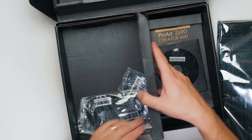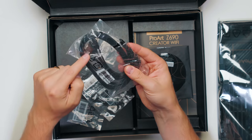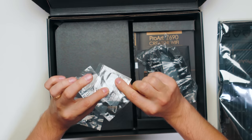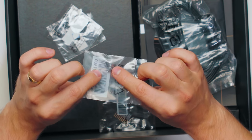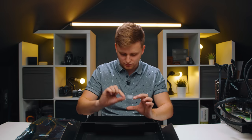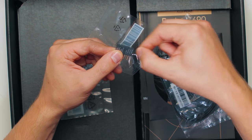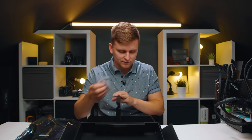Underneath there's a few other things. First of all, we have some SATA cables — two of them are angled and two are straight. Then we have these little rubber square things, and I'm going to tell you why you need them in a moment when we get to the M.2 installation — there's four of them. Then we have the Asus new tool-less M.2 latches that just hold your M.2 drive in place, and there's two more of these. And then we have the front panel connector, which is an amazing thing — you can put all your front panel cables in here and then slot it into your motherboard rather than fiddling about with single small cables. Very, very annoying otherwise.